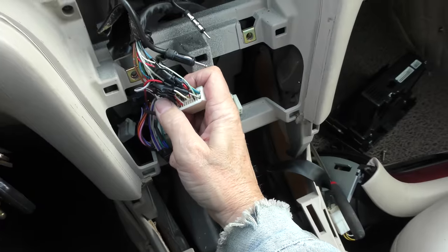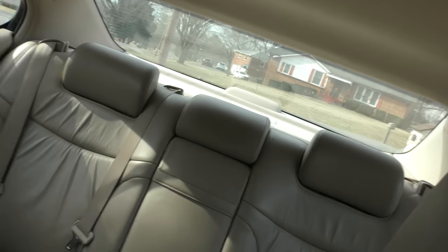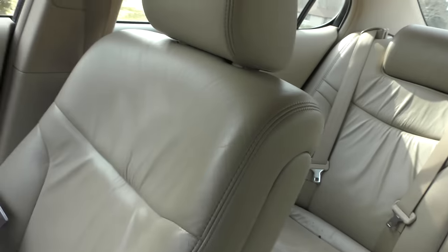There's a wiring harness that plugs into the new radio if you're going to use it for DVD to play out of the speakers and everything, but it will not connect to the wiring harness of the car. It's a beautiful Android setup with all kinds of features — I'll never know if they work or not, because in order to hook them up to this car I would have to rewire all of these wires to each individual speaker and tweeter in the front, the trunk, and the doors. So in this case, it's a massive failure.